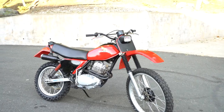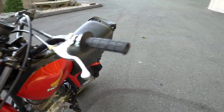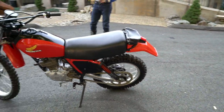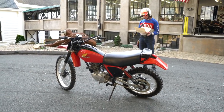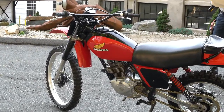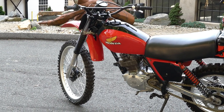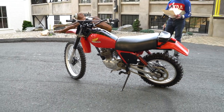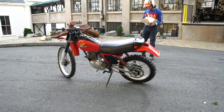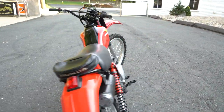It's perfect. The engine mounts were removed, and the valve cover was taken off, and they carefully cleaned the gasket glue from the cover and head and replaced it with the Yamabond, resealed the valve cover, torqued down all the screws and bolts, reassembled the top mounts, adjusted the valves, put a new rear tire on it, put a new air filter in it, set the valve clearance again. Carb was rebuilt, cleaned, new chain. Starts first kick, runs like brand new.